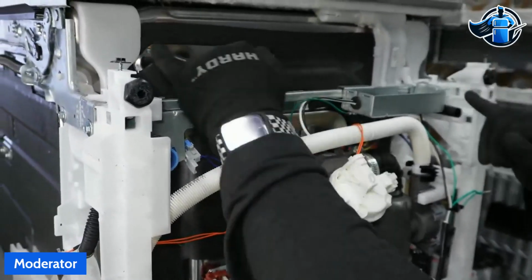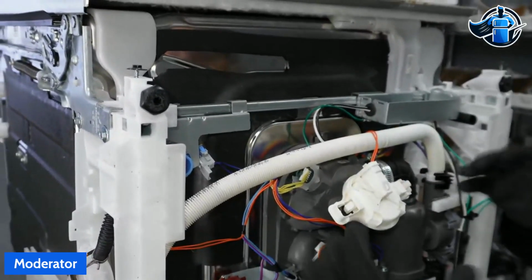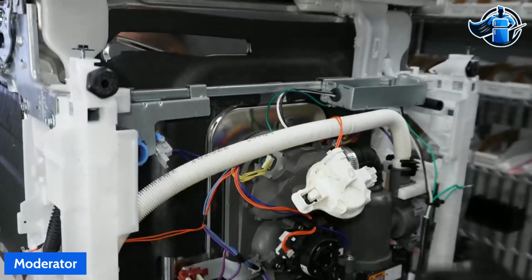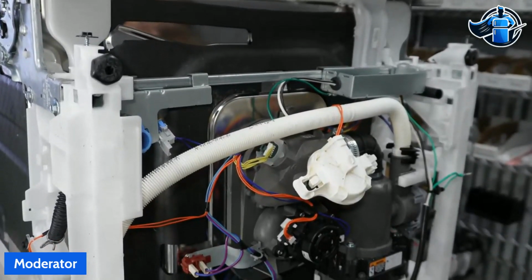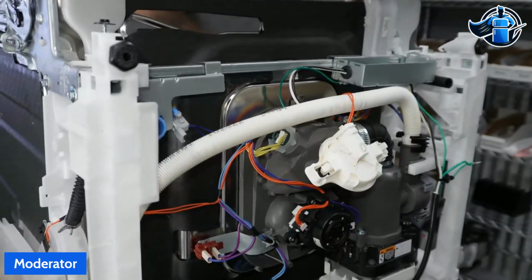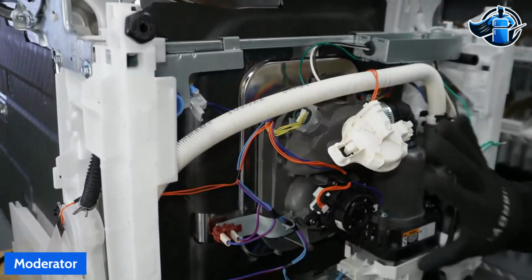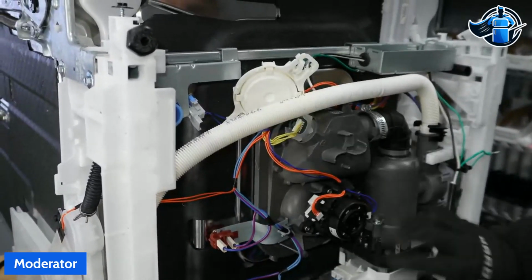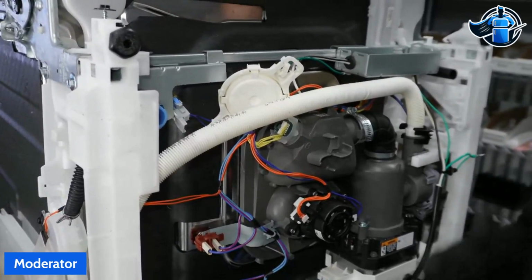It's usually in the corners that you're going to see that wave motion kind of pile up and go over, and Whirlpool designed it to catch that, to prevent any damage to the customer's floor. That's typically what we see. For wave motion, sometimes you can have a pump that's surging that might cause an issue like that. That's more on the rare side.